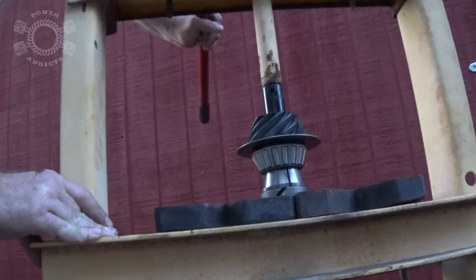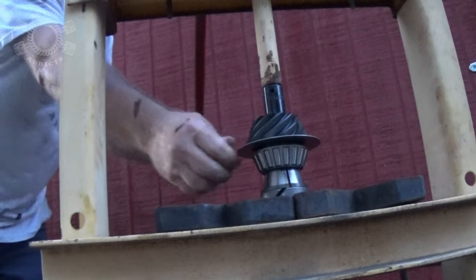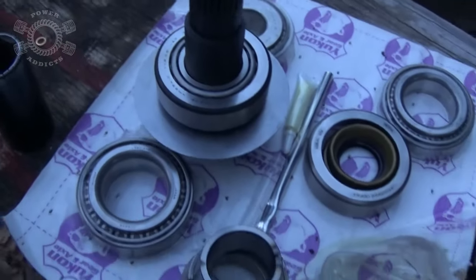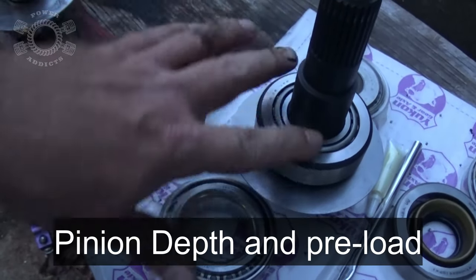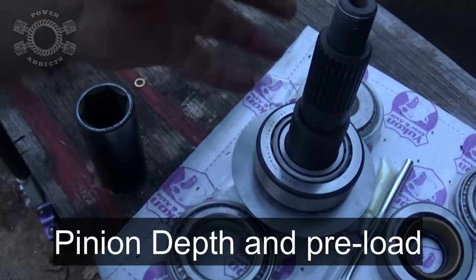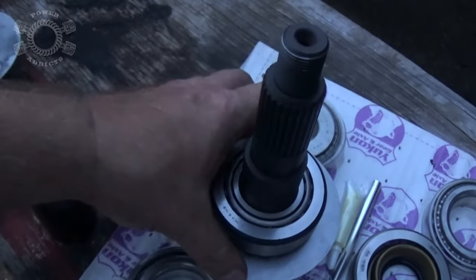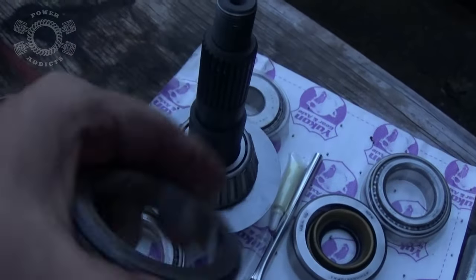About there, about to hit - we are making contact. We're there because the disc is no longer moving. So here's a race - it's going to sit over top of that. That'll go inside the differential. We're going to have shims here. Right here is where the shims are going to be behind this, so it's going to move the pinion in and out until we get a proper preload. When we tighten down the nut right here, the squeeze it creates between your bearing seats and the nut has to be a certain amount. Too loose, your bearings will have too much clearance and they'll smoke. Too tight, they'll squeeze too hard and smoke your bearings. So make sure you get this part right.